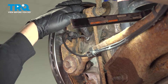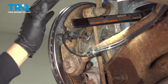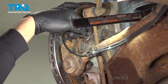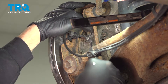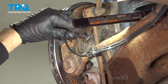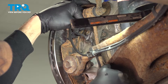Now, the next thing is removing your ABS sensor from the knuckle. A lot of times these are stuck and corroded into the knuckle. If it breaks, you have to remove the brake, the wheel hub, the knuckle — all that to try and get the remnants out before you can install the new part. We're going to use our flat blade screwdriver to get underneath and wiggle this a little bit. Also, go ahead and pop this out of the clip — the wire harness. Just pop that out and work your sensor out.